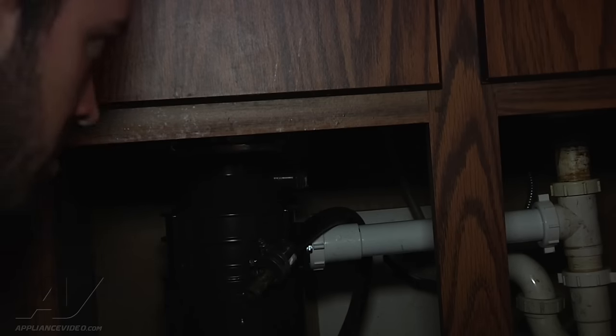There's the drain solenoid pulling down. It's a pretty good drain now. You should kind of hear the pump labor towards the end when the tub is empty. After we snaked the drain line out, that did seem to clear the restriction, and it is draining out all the water completely — so we should be all set to go. Thank you for watching another quality video from ApplianceVideo.com.